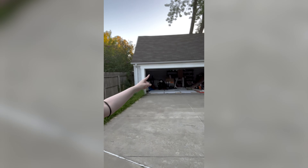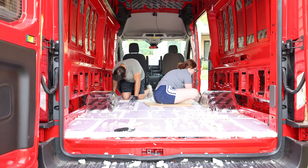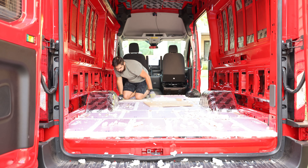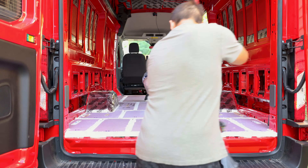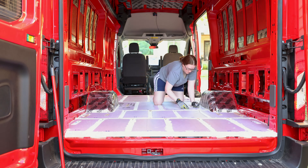Good morning, 6 a.m. Joey's cutting foam. We've got three hours to finish the subfloor before I head to the airport for a job. We painted everything last night so it should be good to go — it's just scraping that foam off, putting the glue down, and screwing it down. We used Great Stuff Gaps and Cracks between the foam and the ribs to get a nice tight seal with no squeaking. That expands a lot so we have to come in and cut and trim everything flush before we screw down the plywood.